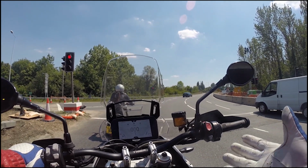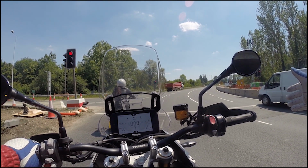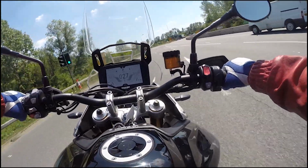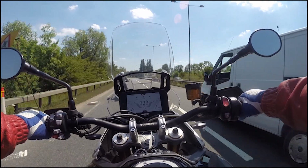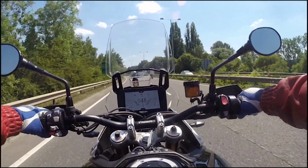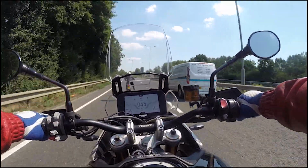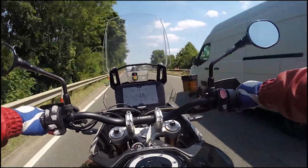I like this thing a lot, other than these vibrations, which I think comes down to that wide handlebar. Look at how wide I am on my hands. If there are any vibrations, they go right out, and the ends are tapered too. The vibrations are the only negative. Yeah, 4,000 RPM, every single gear. Jesus, it's vibing. Even the mirrors are starting to vibe a little at that RPM. Redline is 12,000 RPMs, so why am I getting uncomfortable vibrations at 4,000 RPM?